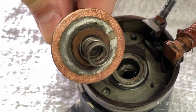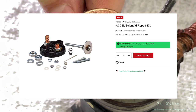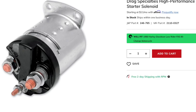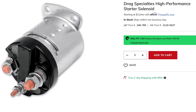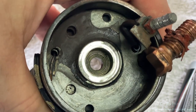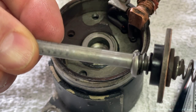The contacts are all cleaned. If any of those contacts were completely destroyed, you could spring for a solenoid repair kit, which would cost less than an entirely new solenoid. If any structural damage was found inside, ultimately you'd have to buy a whole new solenoid. At this point the unit is cleaned out and all the old grease removed, including the cleanup of this part as well.